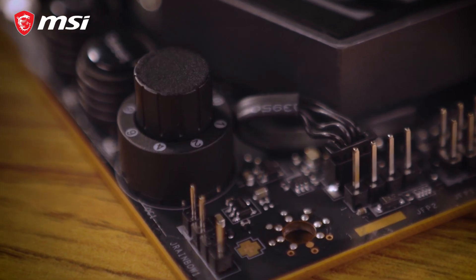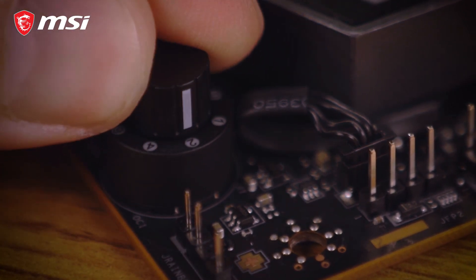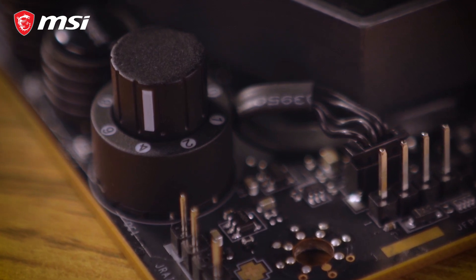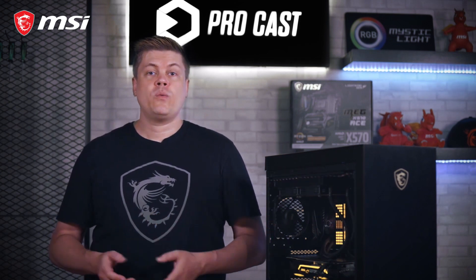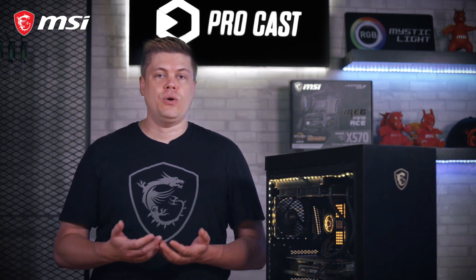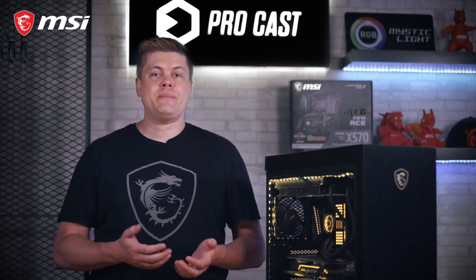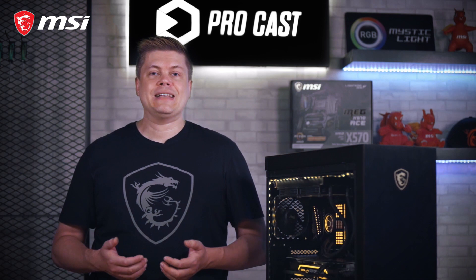Last is our alternate method. You can use the Game Boost onboard dial with the power off, setting it to 4, then turning on the X570 ACE. With our CPU sample, we got a Cinebench R15 score of 3,250 — impressive for a small turn of the dial. Before we updated the X570 ACE BIOS from 120 to 130, we did actually get the Ryzen 3900X to 4.4GHz, though it crashed immediately under load. We also tried Game Boost setting 6, which is 4.35GHz, at a custom 1.4V setting, to get a Cinebench R15 score of 3,422 — it crashed the second time, though, as thermals exceeded limits.